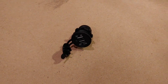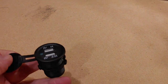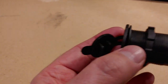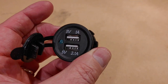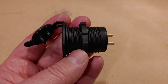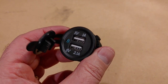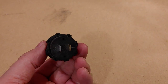This is a USB charging station. I've already got one of these in my camper — this is the second one I'm going to be installing soon. You're able to put it anywhere you can put a hole in the cabinet: drill a hole, slide it in, adjust it, and connect the wires up to the existing 12-volt wire system. It has very little draw, and usually the wires in your camper are way oversized for the amount of current that's going to be coming through these. It's pretty handy because you can directly charge off your main camper battery — in my case that's a lithium one that's recharged during the day by solar.